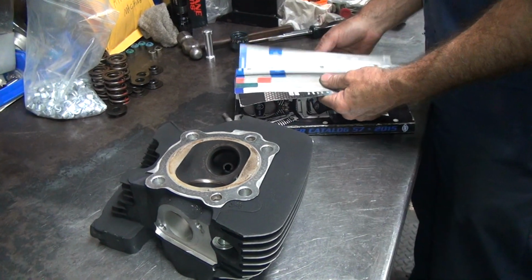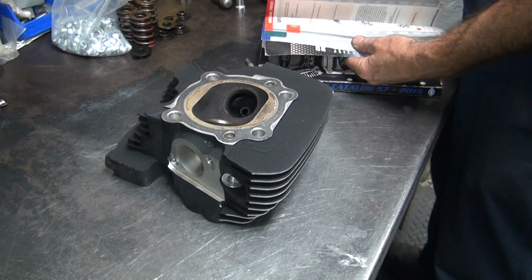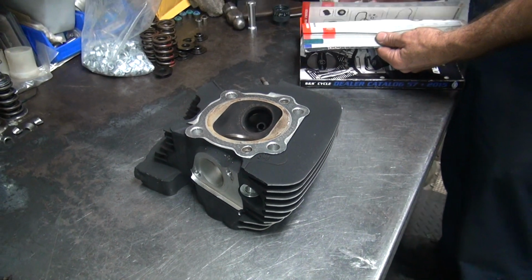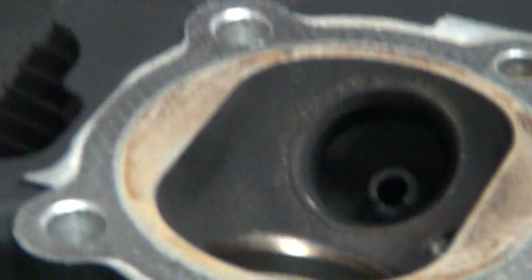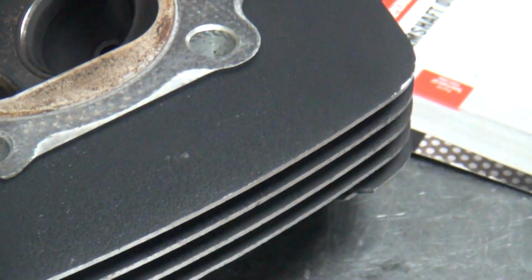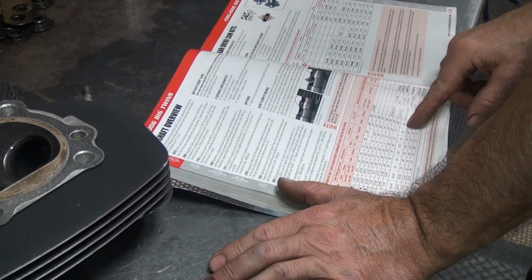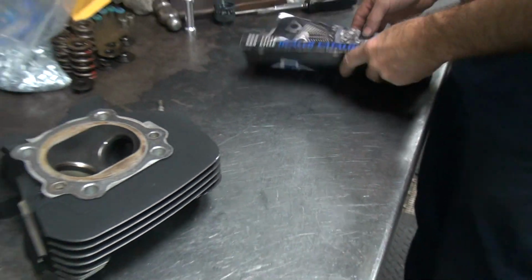Okay, we're going to use a 585 cam, twin cam. What year are these heads? Those are the crappy ones, early ones. I think the cams are all the same anyway. Okay, 585 cam. 585 lift, 186 by 180, so I'll call it 180, 190. Intake lifts more than exhaust.